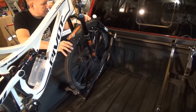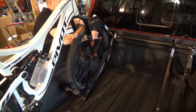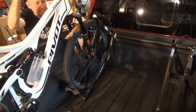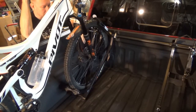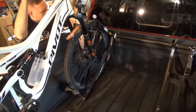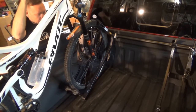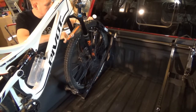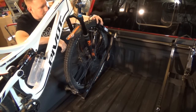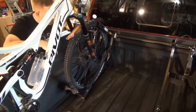In this case the arm is not very tight and the wheel is pretty loose, so all I have to do is loosen that up and tighten the arm down a bit. When clamping the arm down, don't clamp it so tight that you crush your wheel and rim — this is a pretty strong bike rack and it is possible to damage it if you over-tighten. When you go to shut the arm, it should have a firm closure and be squishing the tire down. Then check that the tire is firmly against the bottom chock, firmly against the other chock, and firmly against this wheel. Give your bike a little shake — it looks pretty well locked in.